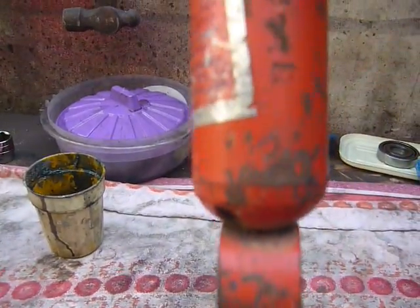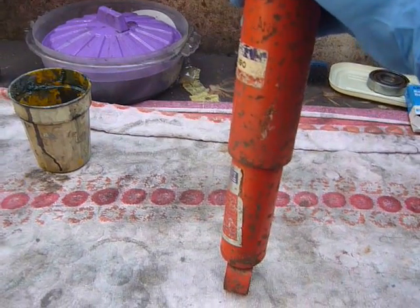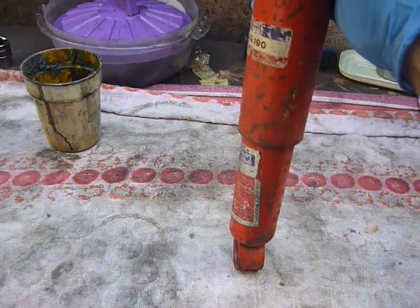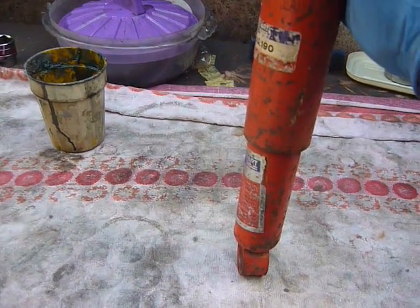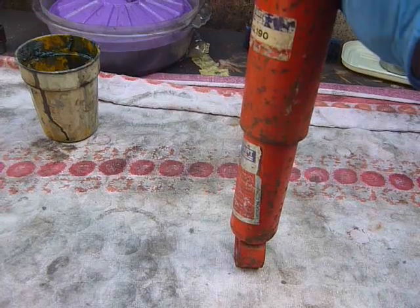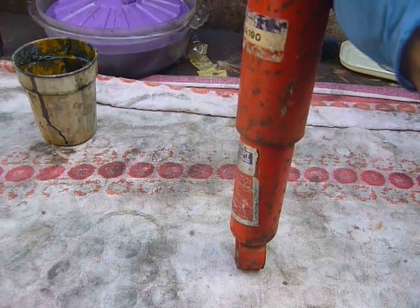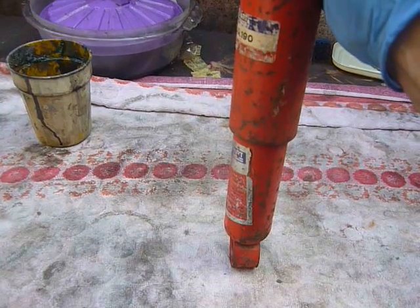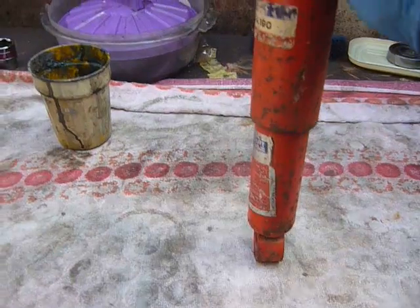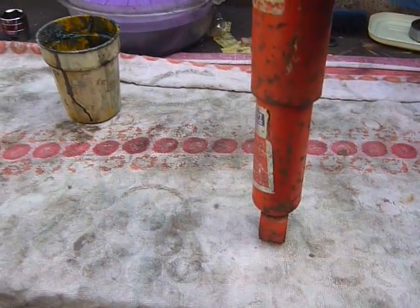What happens is in the bottom down here is a valve system, and when the car bounces up and down and makes the shock absorber go up and down, it squirts oil through the valve — a metal valve, just a plate with small holes in it normally. The car goes up and down millions of times, even small amounts, and the oil gets forced through the hole and gets broken down and gets thin — exactly the same as gearbox oil, engine oil, or any other oil. It gets thin and you've got to replace it.